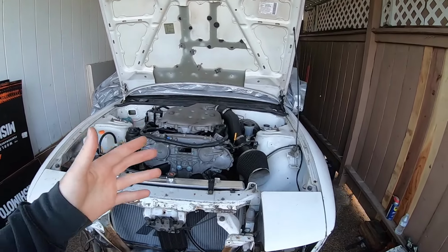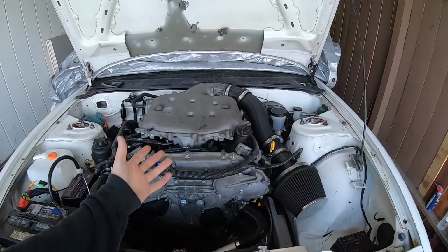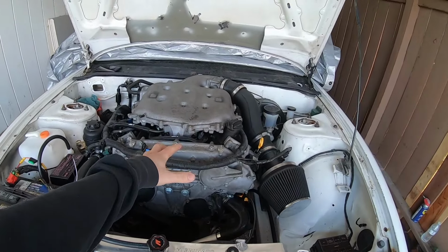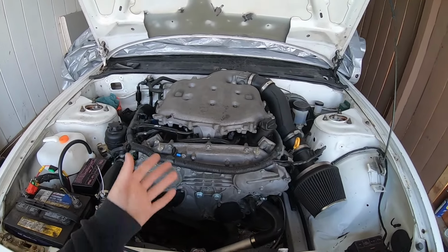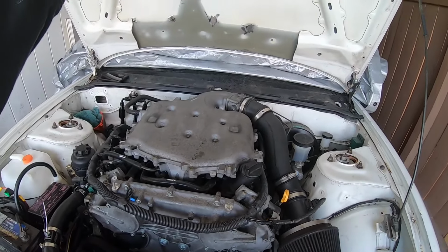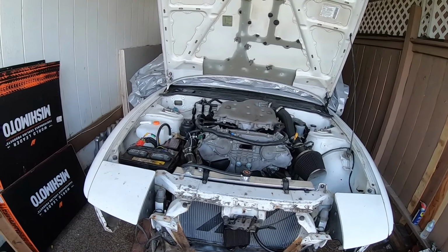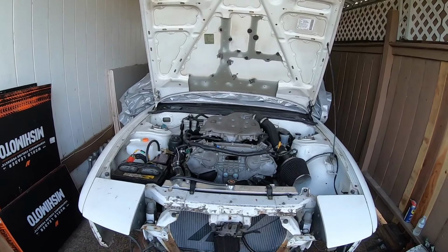If the fuel pump doesn't work and if the fuel pressure is fine, I'm gonna start tearing the top end apart, looking at the fuel injectors and looking at the fuel rail, make sure everything is okay. I probably should have done that when the motor was out and I already had all of this off the car, but it's whatever, it's on now. I just wanna get the car started, so hopefully today is that day.